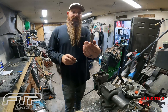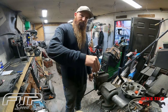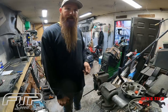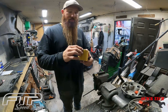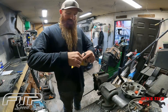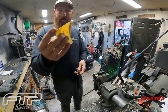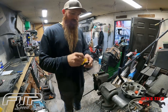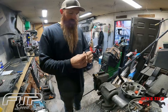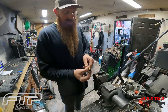We just have a 12-millimeter deep socket — it's a little loose in there. And then we have this 80-grit sandpaper. I use this for block sanding cars, getting the rough cut on the Bondo. We just take off a little bit, and since it's sticky-back it sticks right onto the socket.